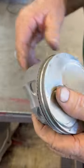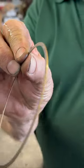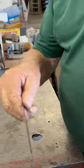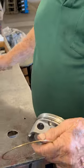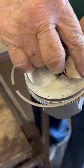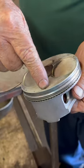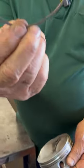This one happens to be where we have some total seal rings, and the top ring is just a little rail instead of a top ring like our normal rings are. Because of this, we have holes in the top of the pistons. Where are those holes for? Compression goes in that hole, it goes behind the ring and pushes the ring out, but the ring is a skinny oil ring.